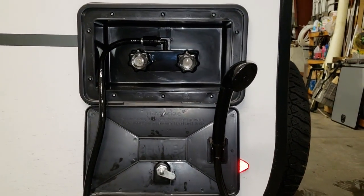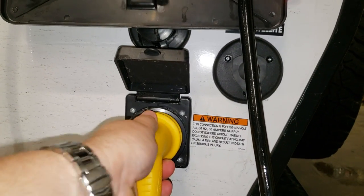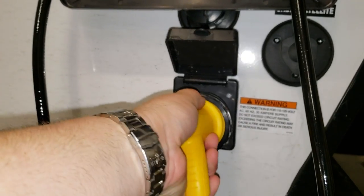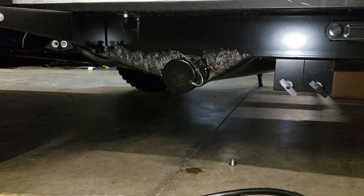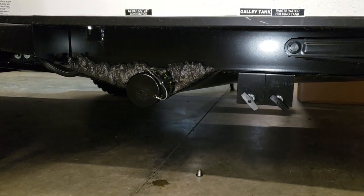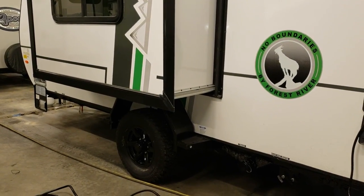Outside utility shower right here has hot and cold water, your black tank flush, and cable hookup. You also have a sealed power cord that actually locks in and you can tighten the knob — it's not a push-in pull-out cord like on cheaper RVs. Down below you'll see your dump handle, gray and black, and where it dumps out. There's also spray foam used to close gaps anywhere the underbelly doesn't quite form well — some people think it's a bee's nest but that is spray foam.